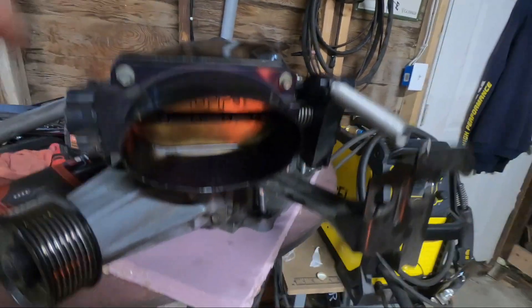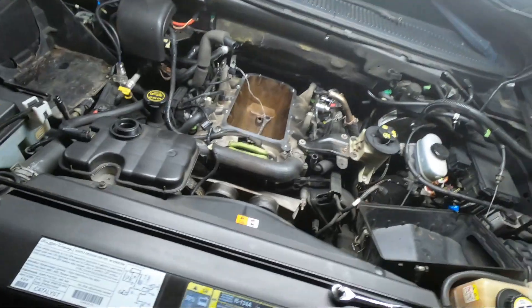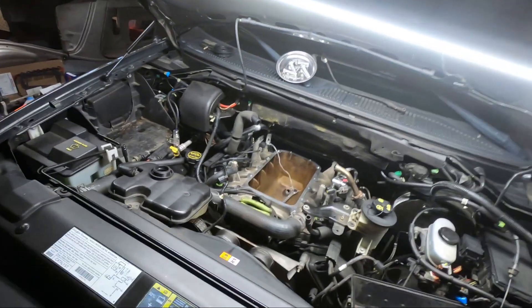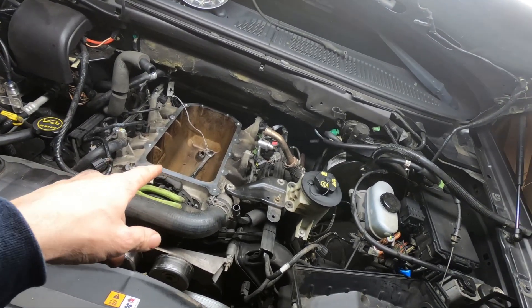The upper plenum on this has been ported. We'll worry about that later because we're going to rip that supercharger off again before too long. I'm going to throw a brass three-eighths plug back in there — plug it in. All there is to it. I'd probably let a day go by before you just fire her up. Let that thing get a good seal.